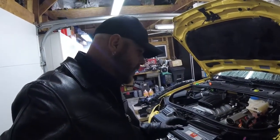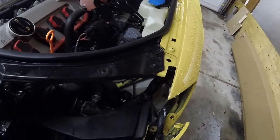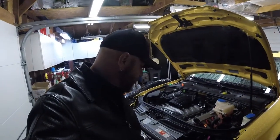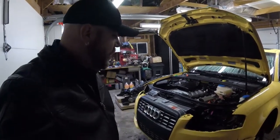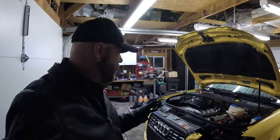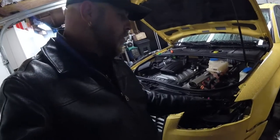For those wondering about the checked washer fluid level - you know it's full but keep having a problem - the sensor is right here. There's a little bit of white silicone caulk I put on there. When I took the headlight out to figure out the water issue, I found someone had cut those wires and tied them together to bypass the switch. That is an analog signal - it was setting a bunch of false alarms on the display because it was a direct short. Don't ever do that.